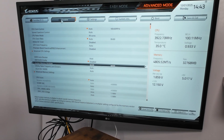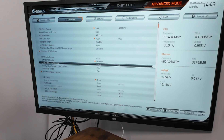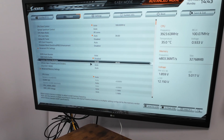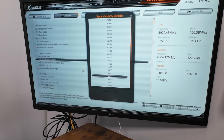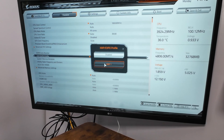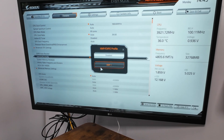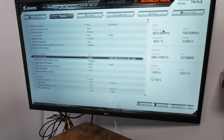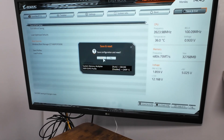There will be an overclocking spot or a tweaker spot depending on your BIOS. With my BIOS, I have an XMP option and the system multiplier. So I can either manually set my memory to 6,000, or I can enable XMP — which I would recommend, as it's the best way of doing it. If XMP doesn't work, some boards won't support it, so you can manually set it instead. Once you have that set, go to Exit and then Save and Exit Setup, and apply the changes.